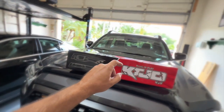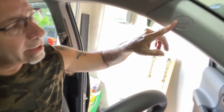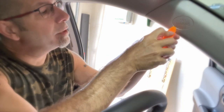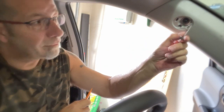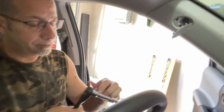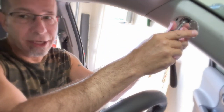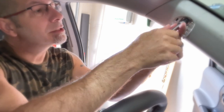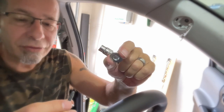We're going to pull the existing trim piece out because we're going to be replacing it. Doing this is really pretty simple. You have to remove this little SRS airbag placard or cover — that's where this pry tool should come in handy. Just grab the edge if you can, and be careful. It comes out just that easily. There's a little holder that keeps it in there, so it's not going to come flying out. Behind that you have a 10 millimeter bolt. We'll grab our socket and remove that. Word of caution: there is an airbag behind here, so if that bothers you, you should disconnect the battery just to make sure it doesn't blow while you're doing this. It really shouldn't, but you never know.